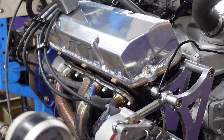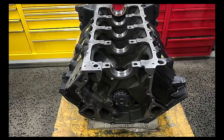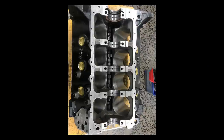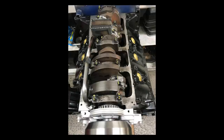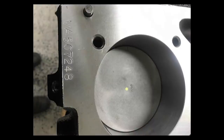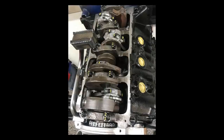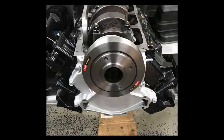This little 308 engine is a perfect example of the next level engine blueprinting and assembly techniques that Powerhouse Engines are renowned for. The engine block has seen extensive testing prior to machining to ensure maximum structural integrity, followed by line honing of the crankshaft tunnels. The crankshaft also passed extensive scrutiny before being indexed ground for correct stroke and accurate phasing, all kept in check with ARP main studs. The factory conrods were tested, resized and lengths corrected with the addition of ARP rod bolts. Pistons are flat top hyper eutectic housed in 20 thou oversize torque plate honed bores, bringing capacity to just under 311 cubic inches with a compression ratio equal to 10.7 to 1, maximizing the owner's choice of 98 octane fuel. The rotating assembly is supported by ACL race series bearings and was precision balanced to the highest standards, complemented by a pro race harmonic balancer.